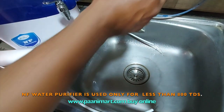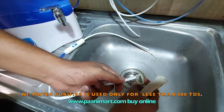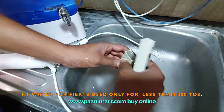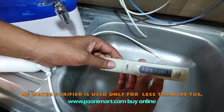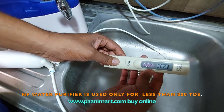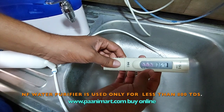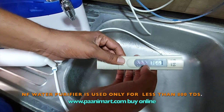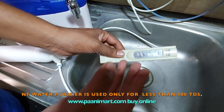Now let us see again — what is the pure water TDS after the nano filter membrane. I will wash it because it is a very sensitive meter. You see it is 375. If somebody needs a TDS level like 400 or 500, they can go for the NF-60 membrane. We recommend this for 500 to 800 TDS level. For example, now I am having an input TDS of 1000, and for 1000 you are getting 366 — that means approximately 60% reduction.